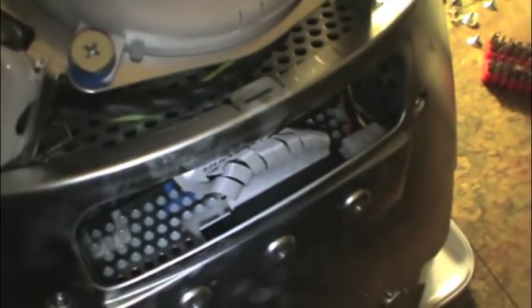That would be fine if Apple was still making parts for these, but the problem is you can no longer buy those. So once you break it, you might as well throw the machine in the dumpster unless you have another cover, because you can't remove it from another machine unless you take the whole cover with you. They use a different power button between the 700 megahertz models and the newer generation like this one. Really a pain in the neck. Just do as I say and unplug this. Don't want to sound too condescending, but I just want to make sure I'm giving you guys clear, concise information.